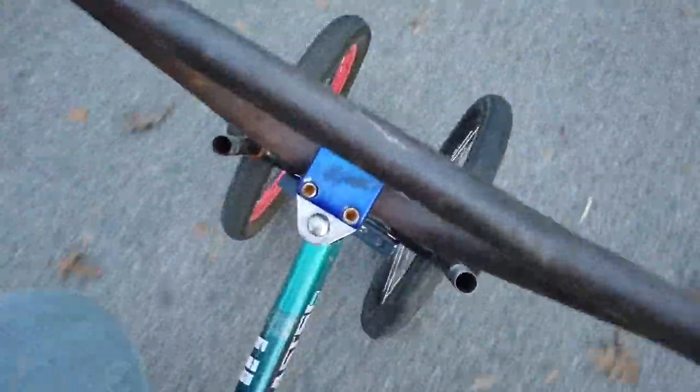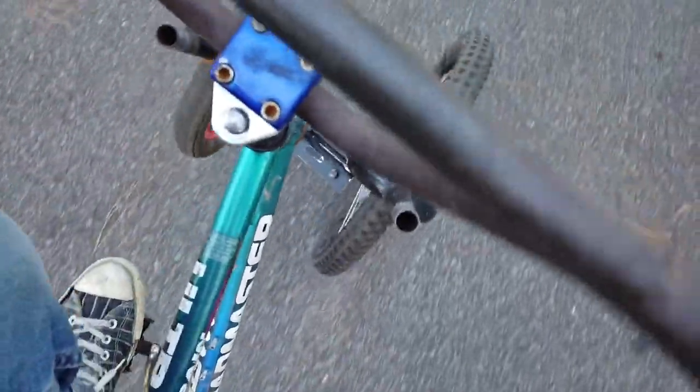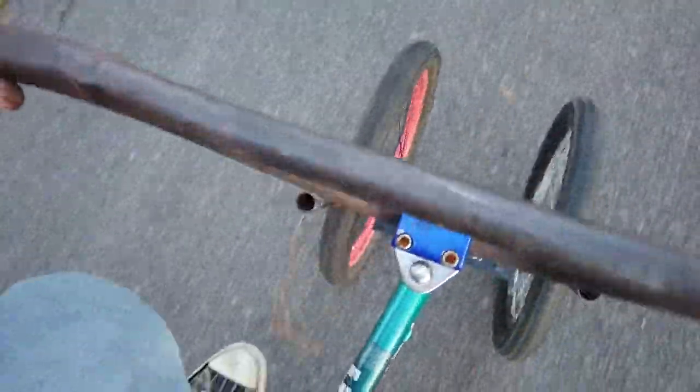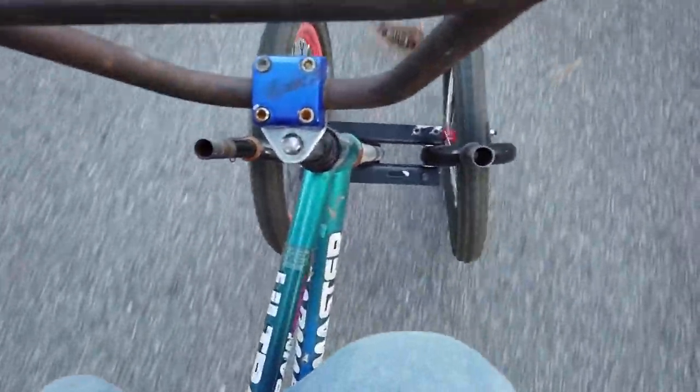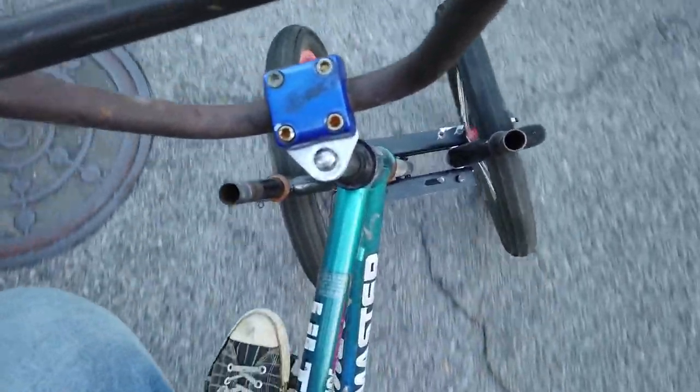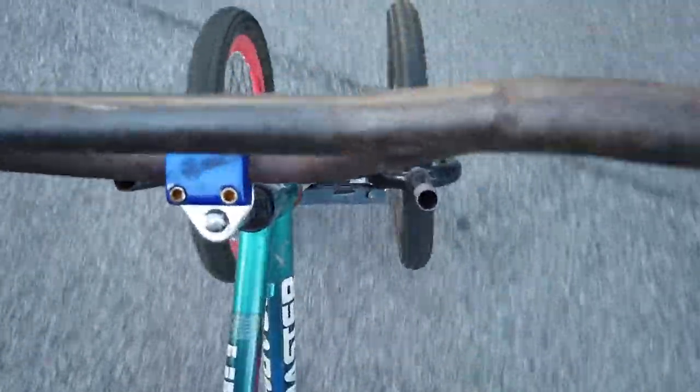It definitely feels weird, but it works, except for that right side wheel. There's something wrong with the bearings or something, and when I lean, it wants to make that noise and grab. Now if I could get that smoothed out, oh, I know what it is doing. That's from the toe in. So if I straighten out that alignment, it'll stop pulling like that.